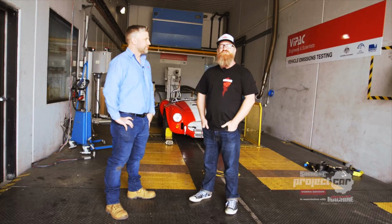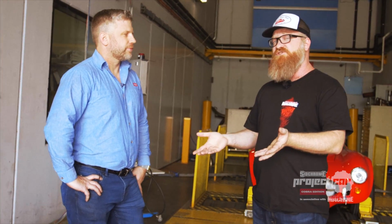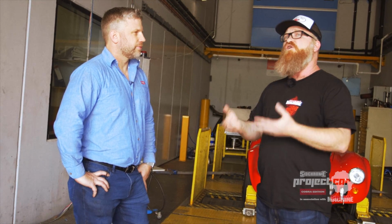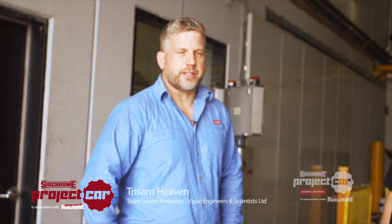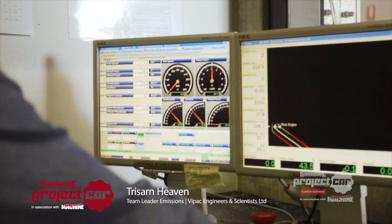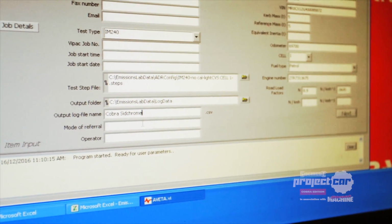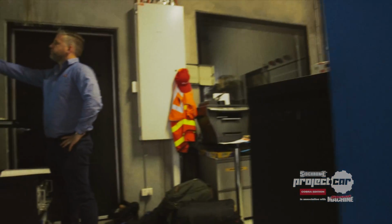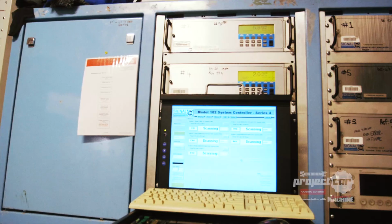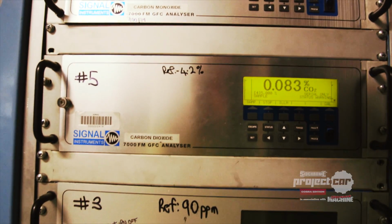G'day, we're down here at Vipac with Chazan. How are you, mate? Yeah, good mate, good. Now, our car is an individually constructed vehicle, ICV. To get this car legally registered, we need to pass certain emissions. What's the test we're doing today? So we're doing an IM240 test today. It comprises of a 240-second test. It's got to meet certain emission standards: hydrocarbons, carbon dioxide, carbon monoxide, and oxides of nitrogen. So this basically is just an entry benchmark for people who want to build low-volume cars and just get it out there and actually prove that it is doing the right thing, emissions-wise.